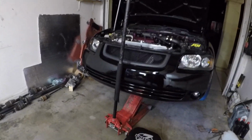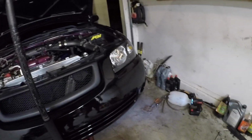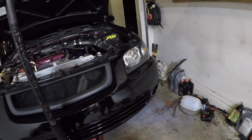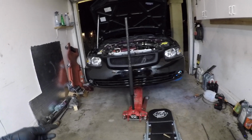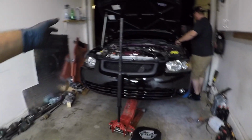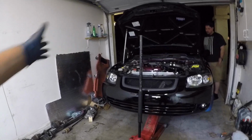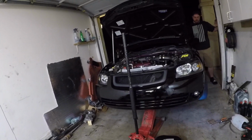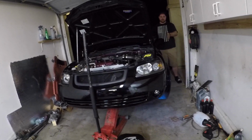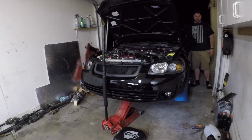You want me to jack the car up higher, so you can get under it? Either way. Either that or I can just turn the steering wheel, bring it back in, and then straighten the wheel out to see how they look. Because that's straight right there. At home, what I do is jack one side up, turn the wheel, make an adjustment, then straighten the wheel back out and put it back on the ground to see how it looks.